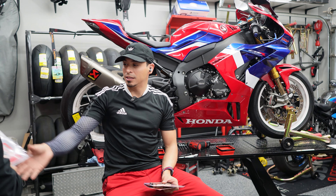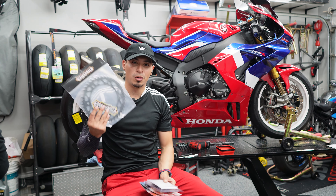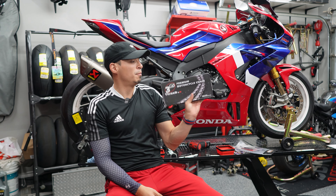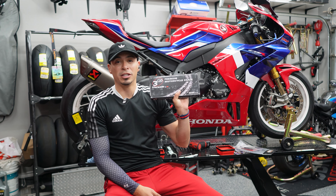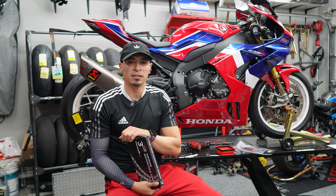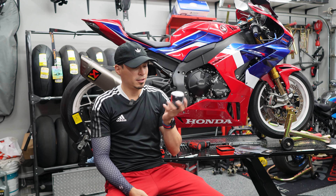For the sprockets we went with the Super Light. Manny recommended these. We went with OEM gearing but did the 520 conversion to make it lighter with a lighter weight chain — the 3D by EK. We went with the gold chain. I think we've rocked this on Mona Lisa and I believe the M has it too. We've always been using this chain across all the bikes.